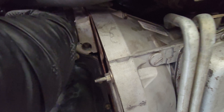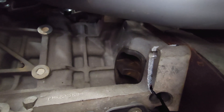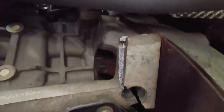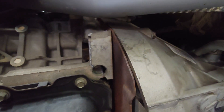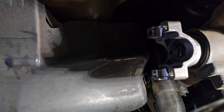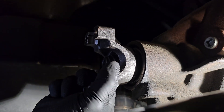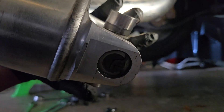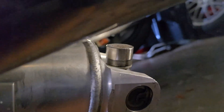What I'm hoping is that if there are two mounts that are jacked up, I can weld that or have someone weld that. And if I have like five bolts holding on to the trans, I'll ride it out. But I won't know until I take the trans out. This is the part I installed — I just want to make sure that nothing here was loose or weird. Everything looks to be good, and the caps are still on the driveshaft here and here, so this end was good.